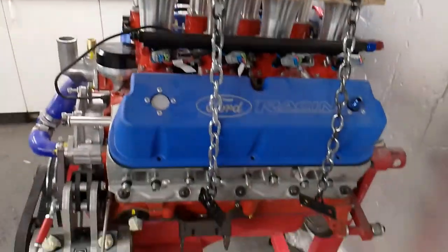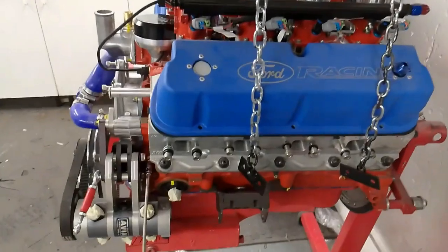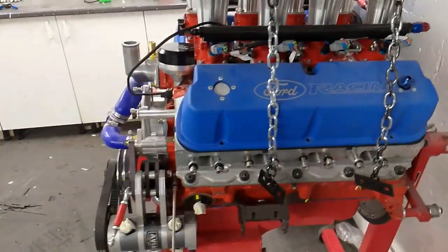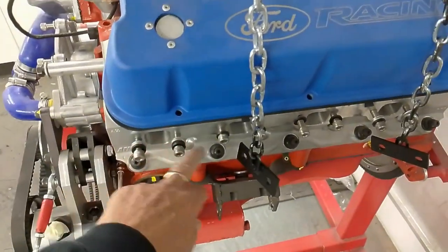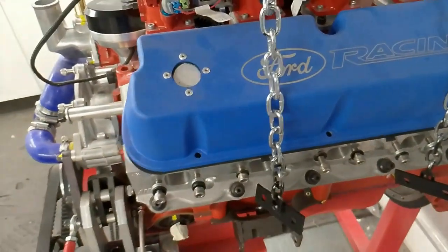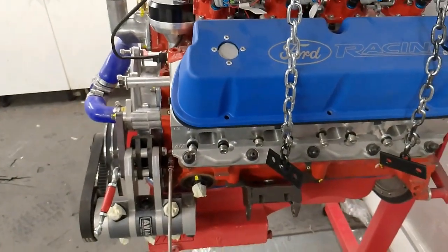I had to make up a frame for lifting the engine, which works quite well — it bolts on where the exhaust would go. So while the engine is out, the other job is to make up little short stubs to come out of each of the exhaust ports so that when it's in the car it gives me something to attach to when I come to make up the exhaust.